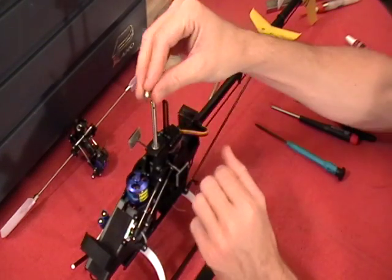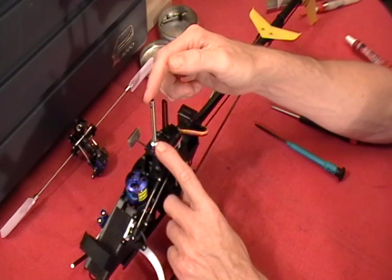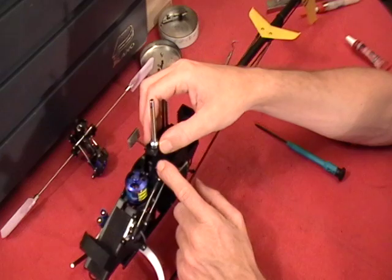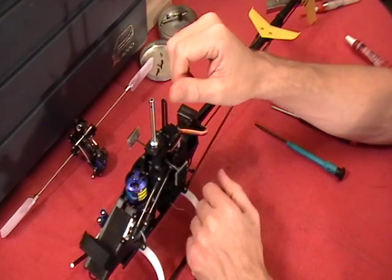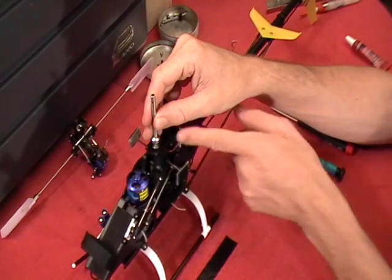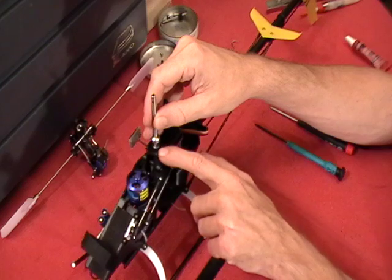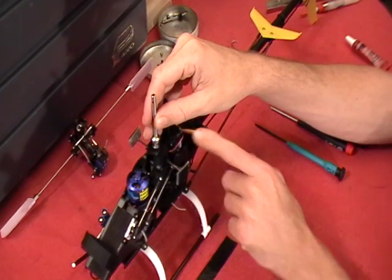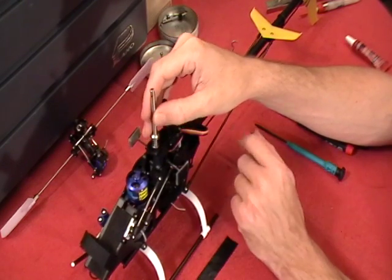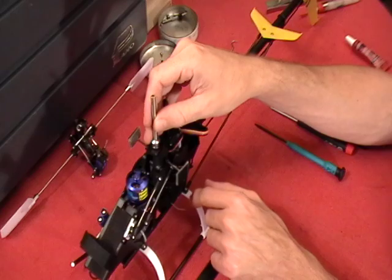Before we pulled off the collar — if you had a pretty severe crash, I mentioned earlier the bend is going to be between the collar and the head block, so you're probably not going to be able to slide that collar off. Don't sweat it. If you start sliding it up and feel any resistance, just let it be. Go ahead and take out your bottom bolt. There's so much support on the shaft through there that there's a very slim chance of a severe bend, but a violent crash may cause some bend and possible damage to your upper or lower bearing. It may be a little stiff coming out, so be careful not to destroy your bearings if they're still in good working condition. Dust or grease may cause a little resistance, but it shouldn't take too much to break it free. Slide it out the top — if the bend is up here, you can slide the collar off the bottom side of the shaft.